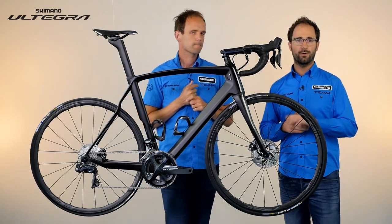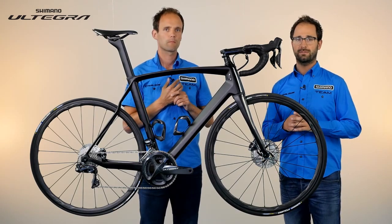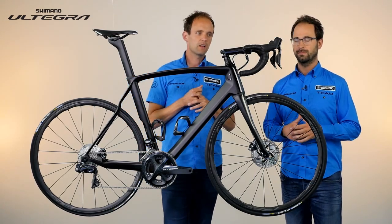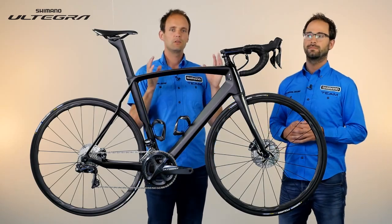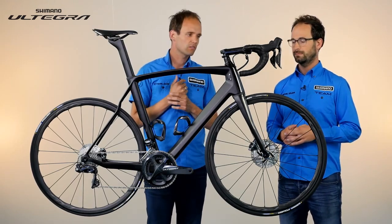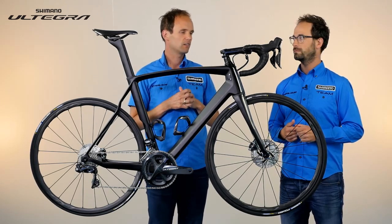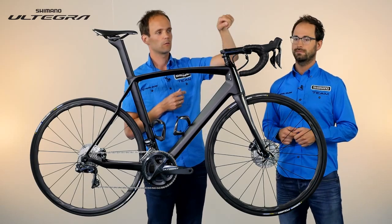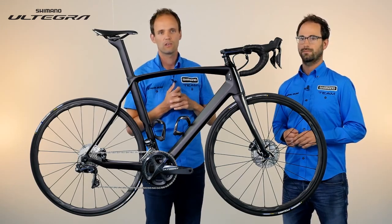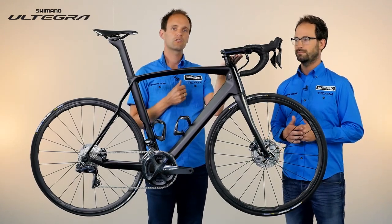Yeah, exactly. A question from Randy van Duren. What about compatibility with existing climbing or sprinting switches for Di2 and junction boxes? Yeah, good question. But there are basically no real limitations on sprinting shift switches or climbing switches or junction boxes. The only restriction to that is you can only have 6 shifting buttons. So one shifter left, one shifter right. That means that you can add 2 sprinting shifters and 2 climbing shifters if you would like. Junction box also doesn't matter. You can still use the old one underneath your stem.